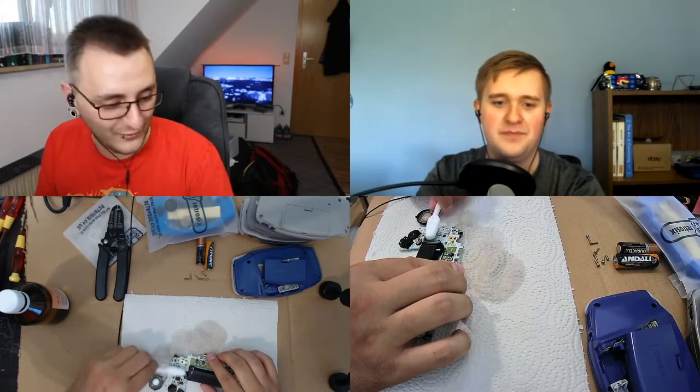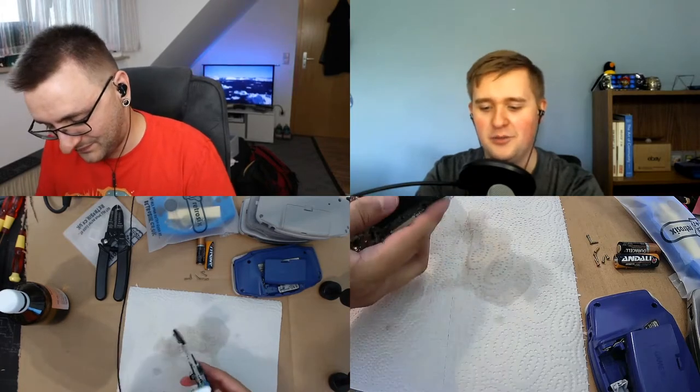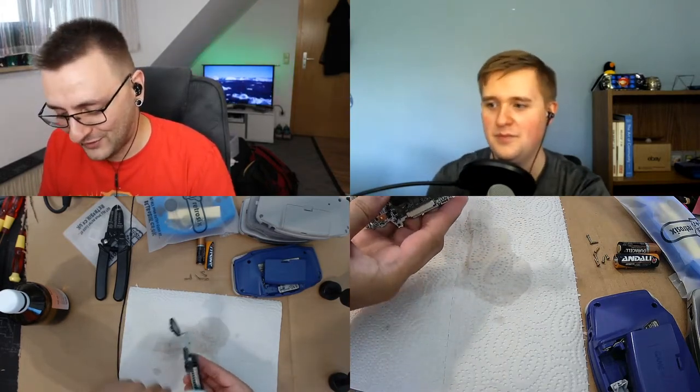I'm using the worst solder I can get — which one should I get for all this tiny stuff? I would use leaded solder, which although you need to take precautions — and if you're going to resell it you need to say it's leaded solder — it melts at a lower temperature so it's much easier to use, and not as bad for ribbon cables. The audio chip is a mess — it's even smaller than my fingernail and it's really hard to solder. I have to add like six cables to that chip.